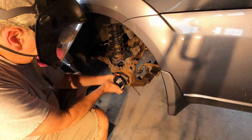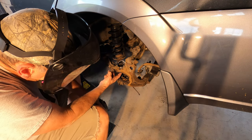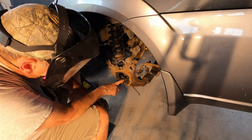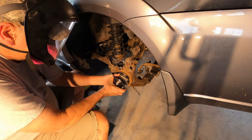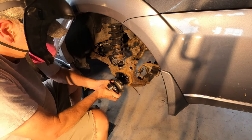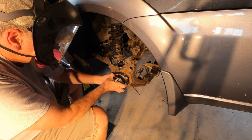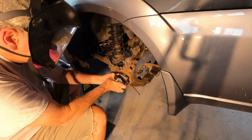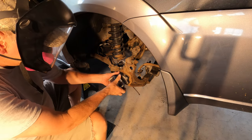This is the first trial fitting of the center hole to its mounting pad. It didn't fit very well at all. It was way too tight in the center hole. It may have been able to be forced in with the bolts, but I'm never one to force fit bearings. That leads to a shortened lifespan. It really doesn't quite fit in there.